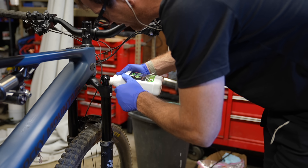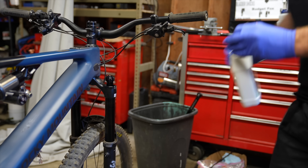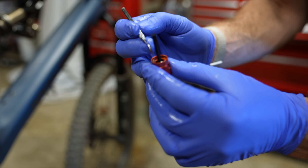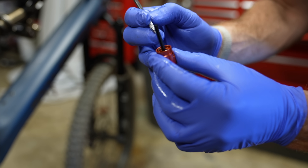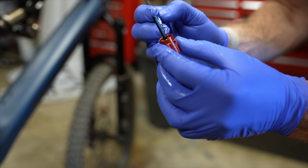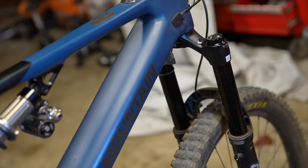I'm a middle-aged male so I rarely read the instructions — I just pour a little 2.5-weight oil in and make sure everything's nicely lubricated. The Version 2 damper has springs and balls for the rebound adjuster, so the rebound clicks are a little more defined than Version 1. But springs and balls means installation is a little more difficult. They give you extra springs and balls, so this thing is definitely designed toward the DIY style.